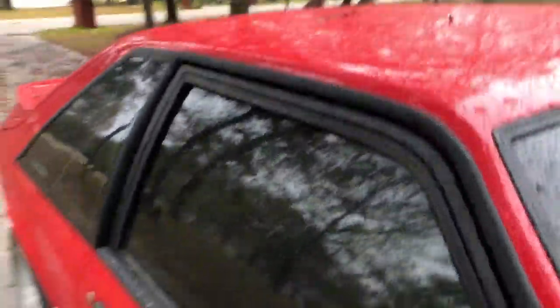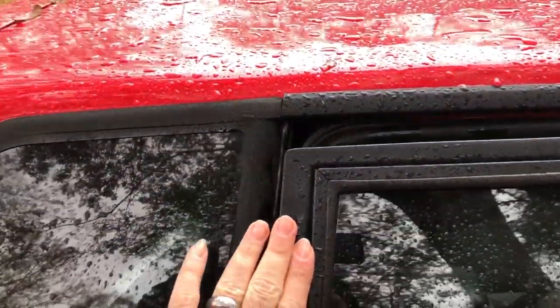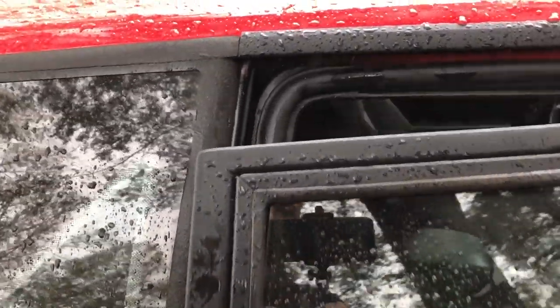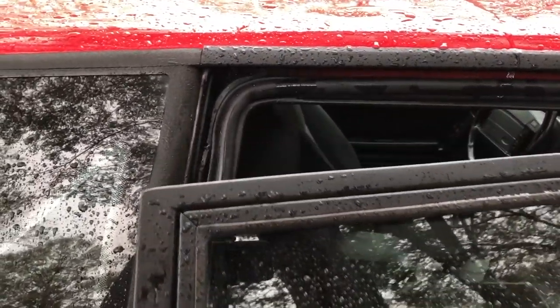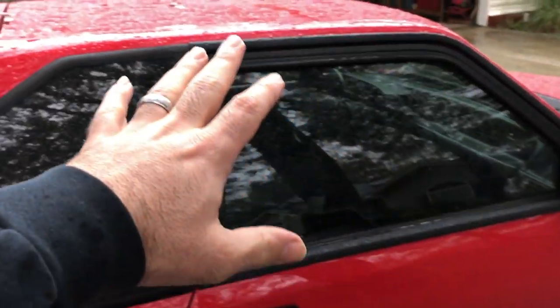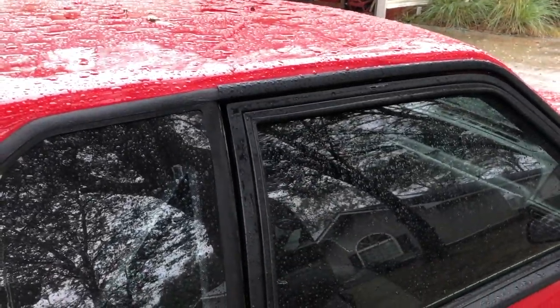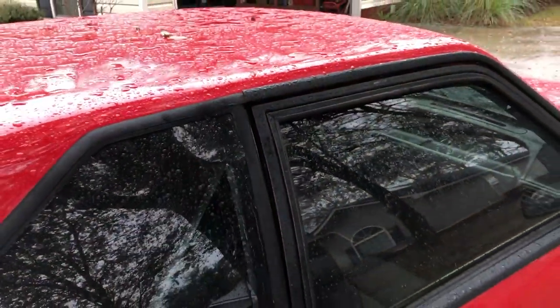I'll show you guys an extreme example of what I'm talking about. On this window, you can really see a difference. That side is jacked way up — it was worse than that but I've adjusted it some. The problem is worn out door pins. As I shut this door, you can see that the door moves up. The hinge pins are worn out and we did not replace these, so it has to catch that latch and then pull itself up. It tries to kick out the outside of the door and the window.